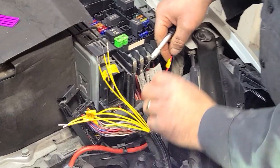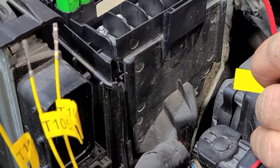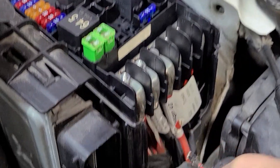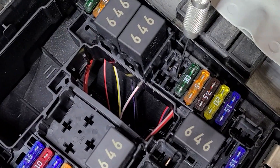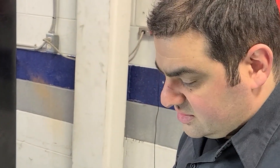You've got your power wire here and you can run it up through here. I took this plate off the front of the fuse box and you run it right into the bottom of the fuse box, fish it up, and you can use that terminal right there with a 15-amp fuse — the power's already there, so we just need to connect that wire to it. Now you've got power to all the injectors and you're getting the signal to them from all the wires, as well as the wires for the pressure sensor on that rail.